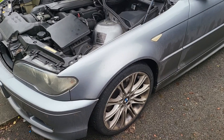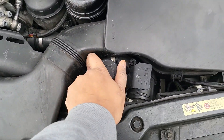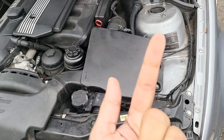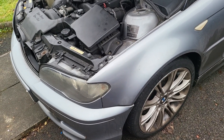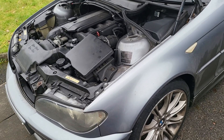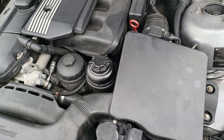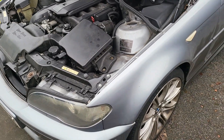The first thing I'm going to do is jack the car up on the passenger side. This is the cap and this is the bleeder valve right here. I want this to be the highest point on the car, so I'm going to jack it up on this side. Any air that is trapped will have a high point and will be able to exit from there. This valve is pretty much the highest point in the cooling system, so any air in there will come out.